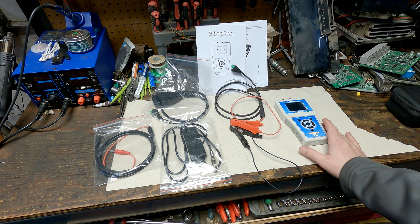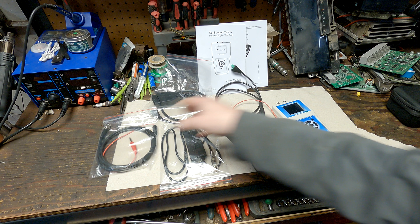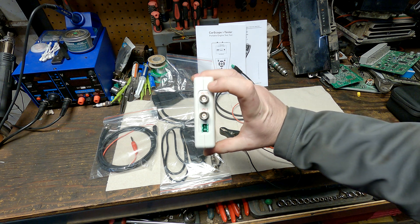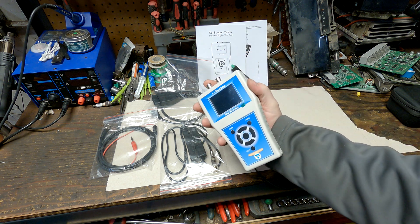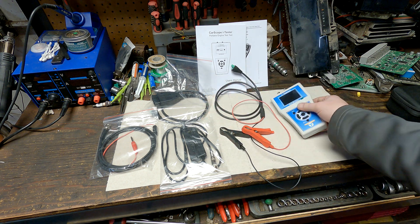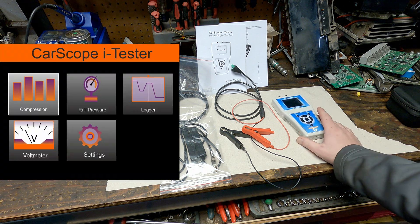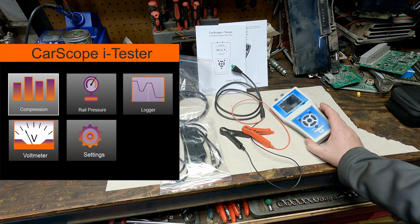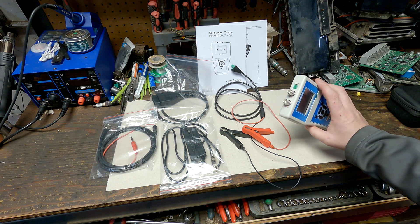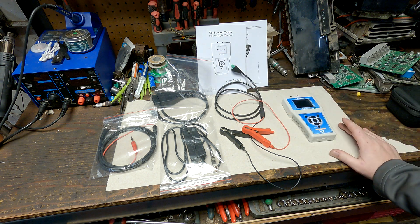The tool also has a voltmeter — you can hook it up to the battery and add your other BNC connection to the IN15 input, and that'll get you a 15-volt voltmeter for some basic testing. It's got a nice little needle sweep. There's also a data logger that'll record for quite a long time, so you can set it up with a shunt to do battery draw testing, or use a normal current clamp on the 2-volt channel to monitor battery draw over time.